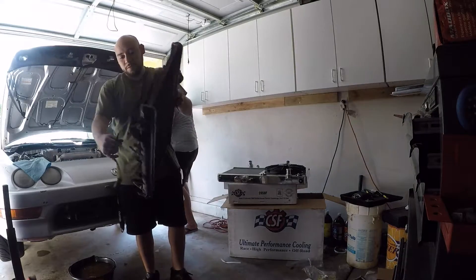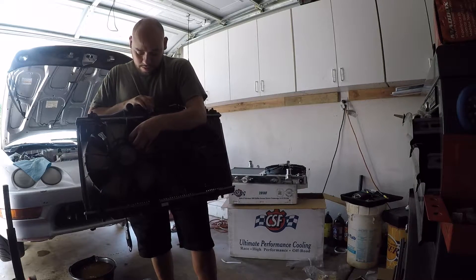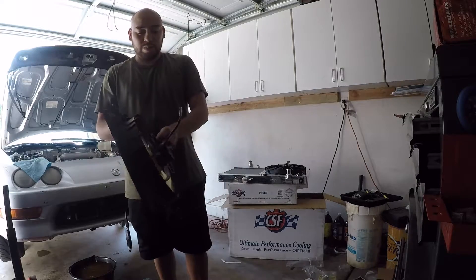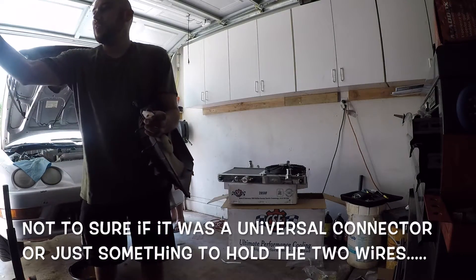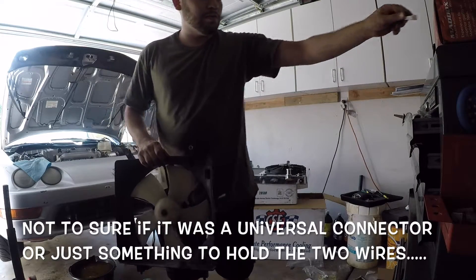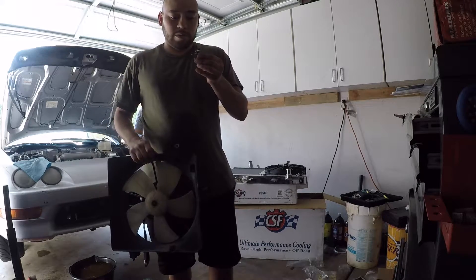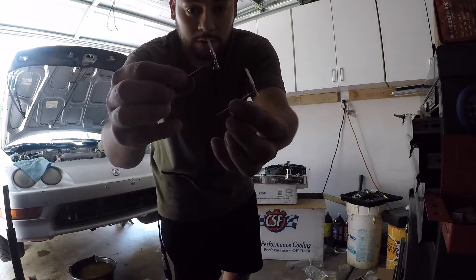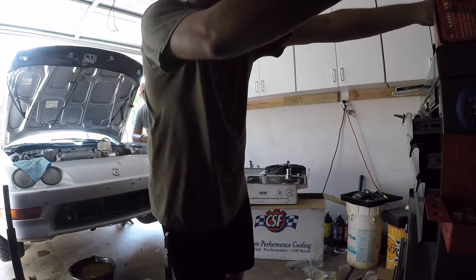That fan's out — I removed the other fan from where it was mounted. The fans are removed. For those wondering, the small fan comes with this small connector right here. It doesn't work with the harness that was on the car. Remember, it's swapped, so I think it's got an EP3 radiator on it, or an S2000. So on that plug, we pulled out the terminals that went in there, pulled out the small fan ones, and we just slipped it in, which I will show you closer.